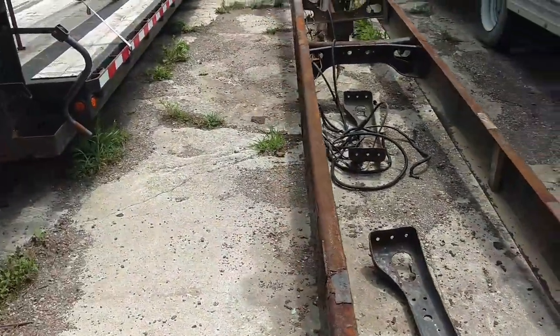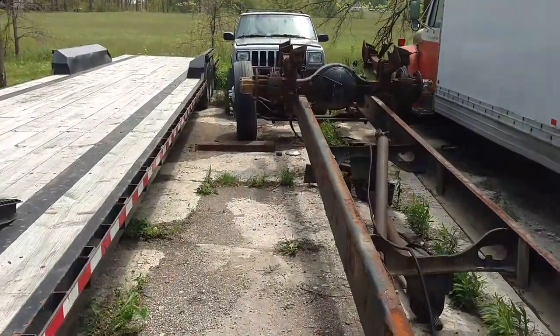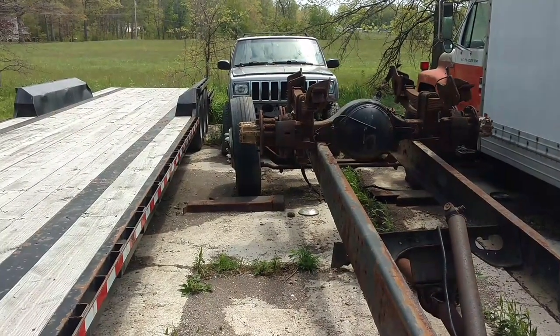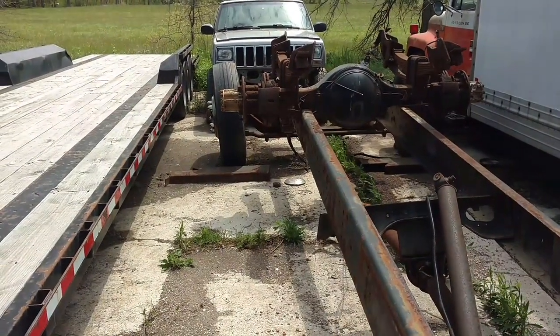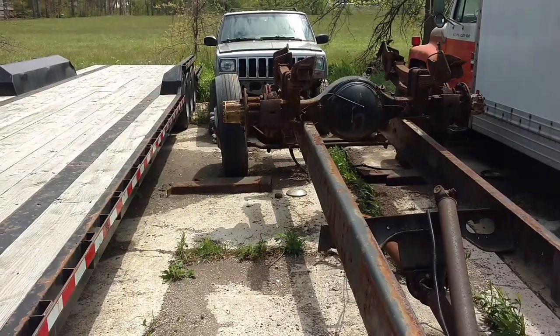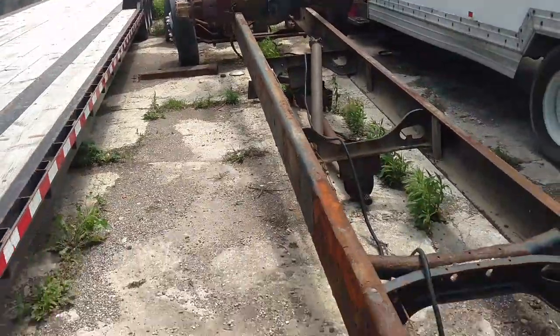If you can see — look at that front tire, look how it's leaning, topped out. That's how bad those kingpins are. They got bad and the guy that had the truck before me was going to change kingpins, but he tore it apart and saw it was too difficult for him. So he ran it for another six years — he pumped grease in it once a week, thought that'd be just fine. But obviously not.